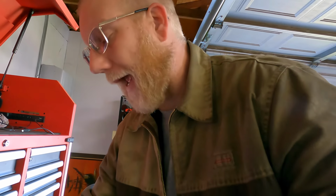I took the tape to it, and it seems like there's about a half inch difference from the front of the rocker panel to the back of the rocker panel. We're gonna move the back up an inch, see what that looks like going down the road, and then if the back end looks higher than the front, then we'll raise the front to match. That way she's a little taller also to get in and out of the driveway.